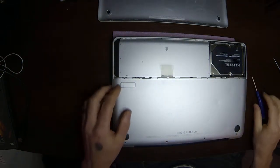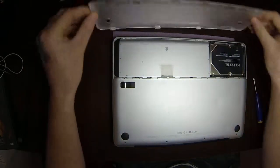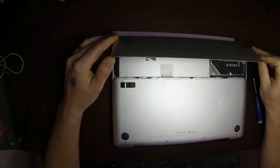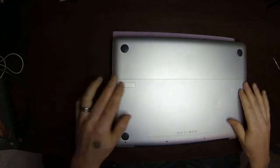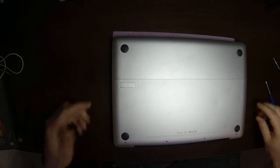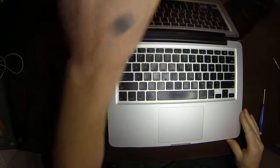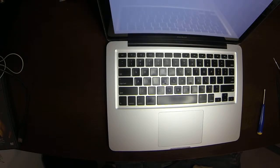Again, this lever has to be popped open in order to put the battery tray back on. Kind of at an angle like the RAM and the hard drive and the battery — we stick that in, press it down, and once it presses down it actually locks it into place. We've replaced the memory in a MacBook in basically 10 minutes. Powered on for good measure — there's the chime. That's a good sign — means the memory is taking.